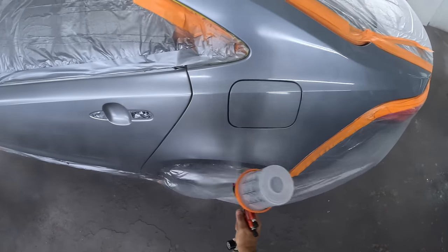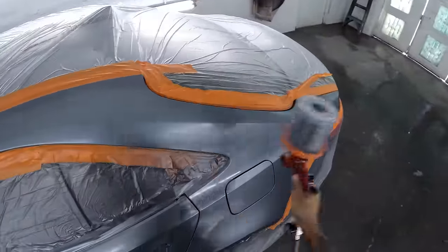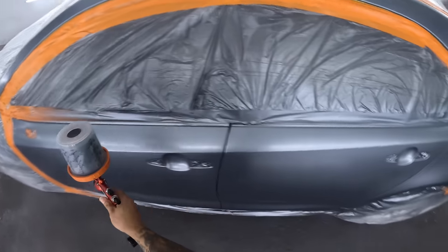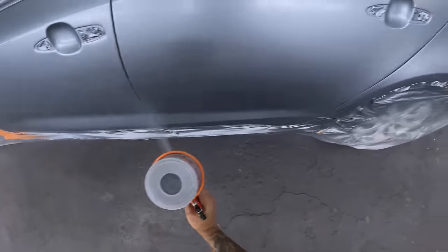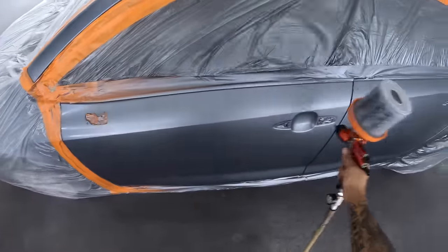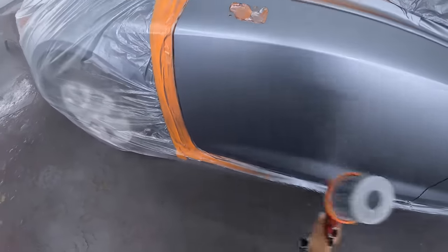Some people like to put the wet bed down after the sealer to kill the sealer edge — that's nothing I've ever felt the need to do. Going with 20 PSI doing my blend. That whole 'kill the sealer edge with wet bed' — I see a lot of that from these TikTokers. You know, the TikTokers add a whole new element to painting, so you got to keep up with the trends. But Trigger Man is old school, we can't keep up with them TikTok trends.